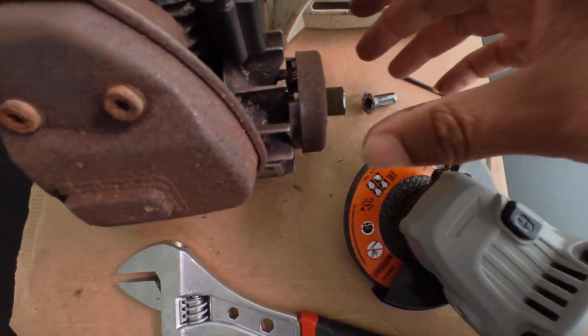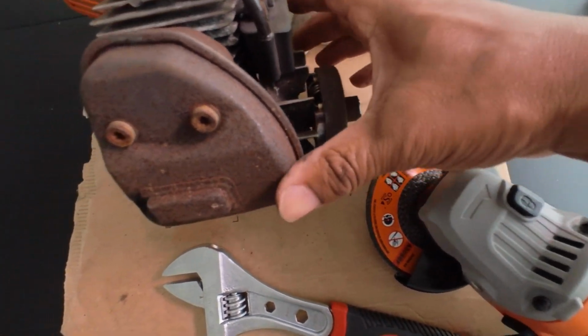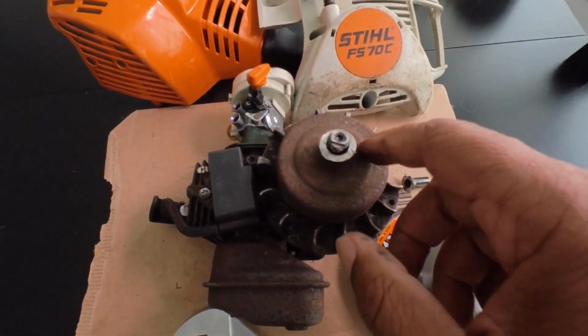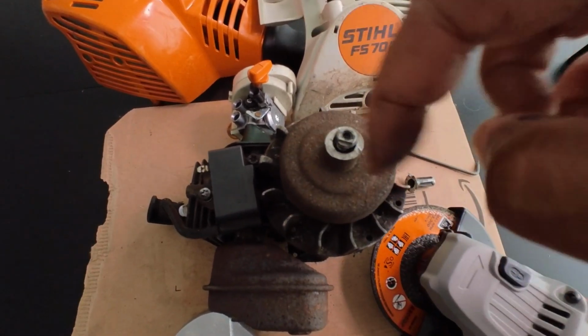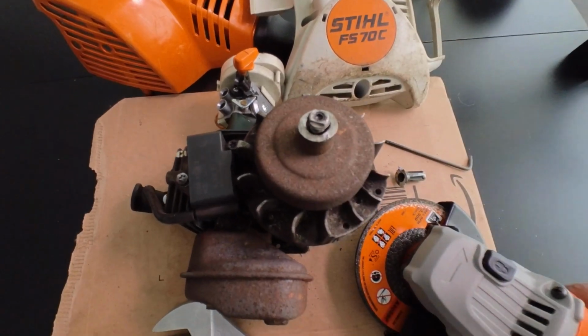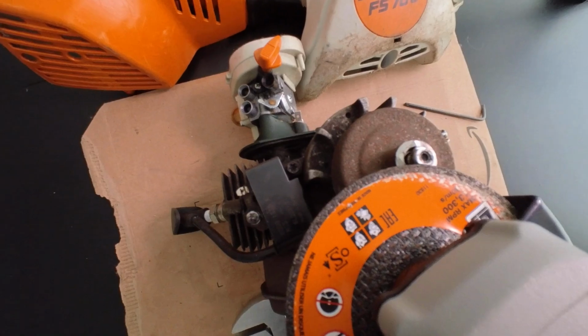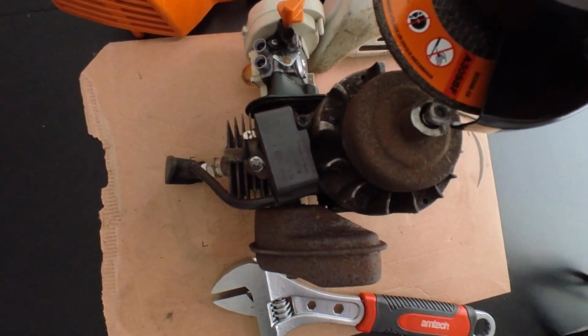And then I tilted it on its side. Well, this came off, I tilted it on its side, so now I have access to the screw. The screw is much further down. You still can't take it out because there's a ring underneath it to hold it on. Took the angle grinder and I cut a flat surface right here and another one right here.